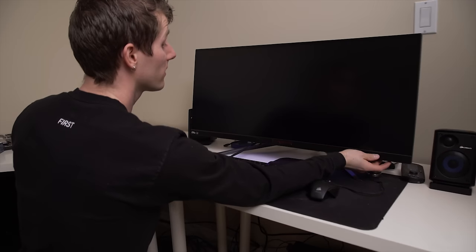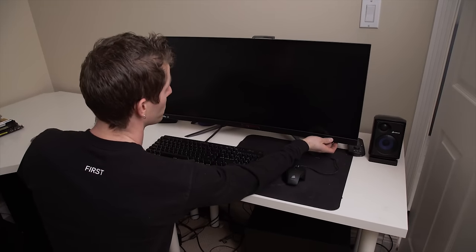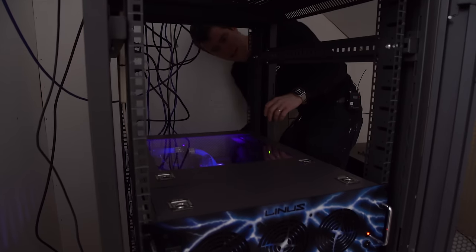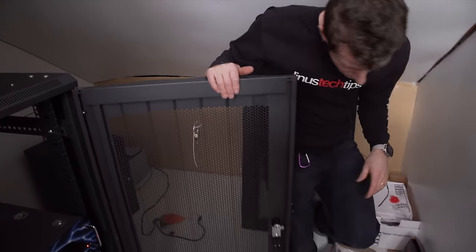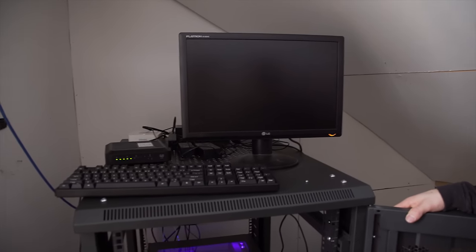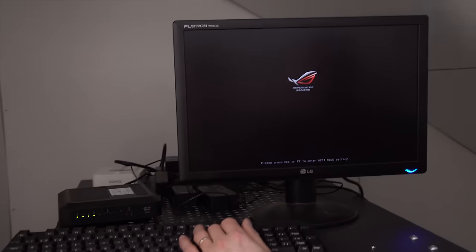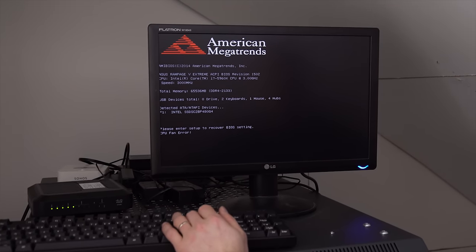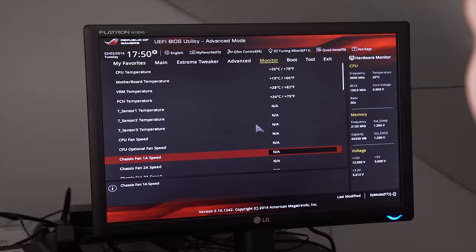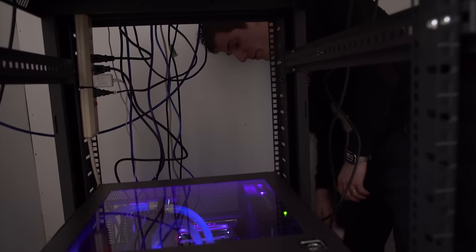This one's actually relatively tested — I have at least tried the ASUS Thunderbolt card on this one. Let's just give her a reboot and see what happens. Maybe something was just jostled loose in shipping. Post code A2 — CPU fan error. That's no big deal, I have a CPU fan, it's watercooled. In theory we should be fine.